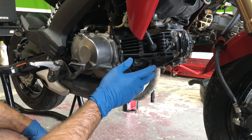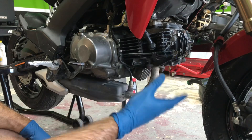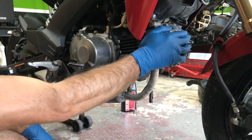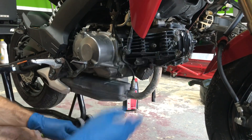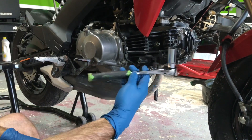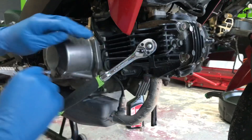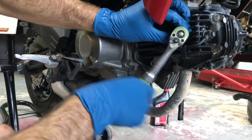On the right side of the bike you'll find where your spark plug sits — it's right down here on the motor. You want to do this when the motor is a little cold so you're not burning your hands. This motor is definitely cold enough. Just take this wire, pop it off, tuck it up out of the way. Then take your ratchet with your spark plug socket, go right in, get it on there, crack it loose, and simply pull it out.